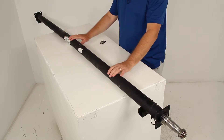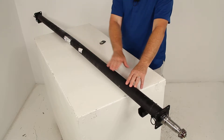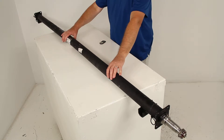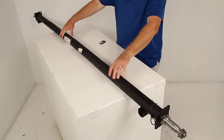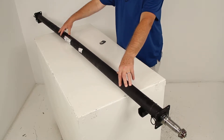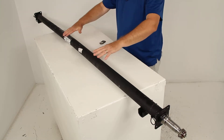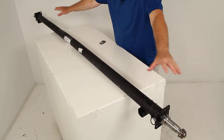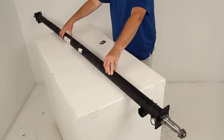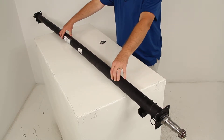The other nice thing you might notice on axles is they will have a rise in the center of the axle. It's hard to see on this video, but basically it'll rise in the center and then go down. The reason they do that is to ensure the proper camber angle — this will ensure that the angle of the wheels on your trailer are correct for your towing needs. Basically, this bend being higher means that when you put a load on the trailer and it weighs down on it, it'll actually straighten that axle out some, and then it allows your tires to have even road-to-tread contact across the width of the tires. This is best for straight-line acceleration and steady, controlled towing.